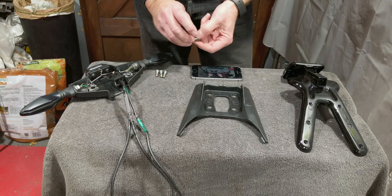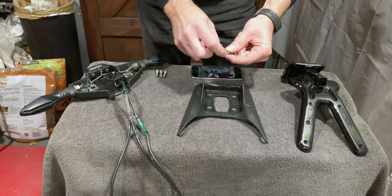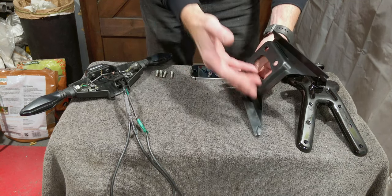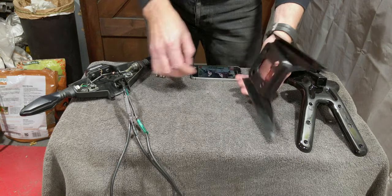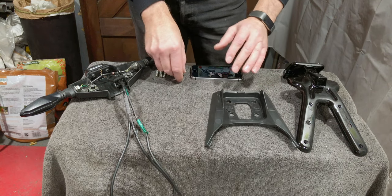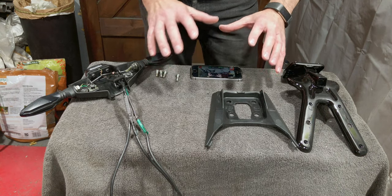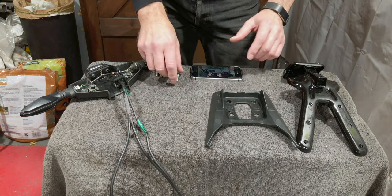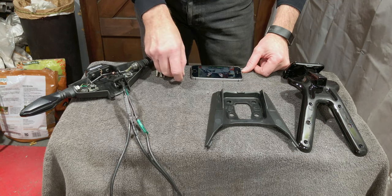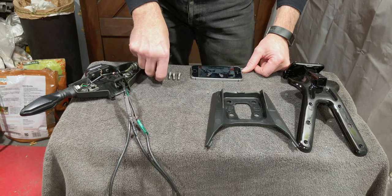And I also suggest that the bolts that you use to fit it on, you make sure that you lubricate them with some sort of grease, because this underneath here where these sit, because these will sit in these holes here, just gets sandblasted with dirt and water, and in this country salt, and it's the most corrosive environment for it, which is why I had real difficulty getting the original bolts out. Now these are actually the stock KTM bolts. In my aftermarket tail tidy, it had cheap bolts.